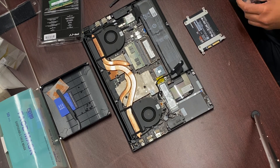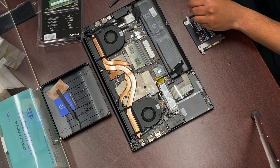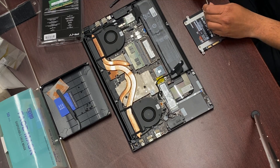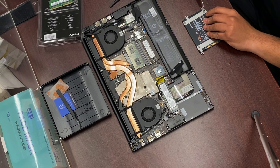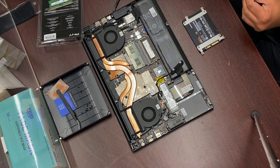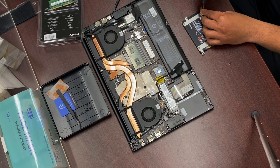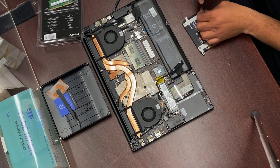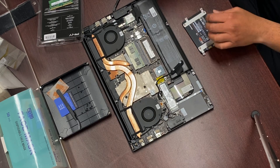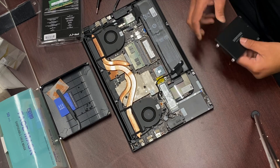If you are using a mechanical drive, a mechanical drive has a magnet, so I would recommend you stay away from that center part of the section. Since I'm doing this on an SSD, it hardly matters — I can touch the casing because there are no moving parts on an SSD, whereas on a mechanical drive there are moving parts inside. So be careful if you are putting a mechanical drive inside. Also, I would highly not recommend putting a mechanical drive because your laptop will be running hot, and it's unnecessary in 2021 to replace a laptop drive with a mechanical drive.